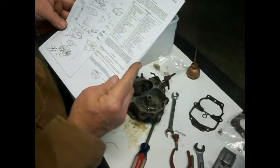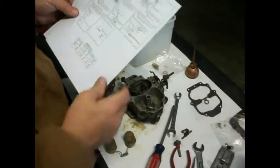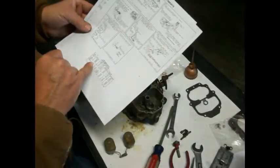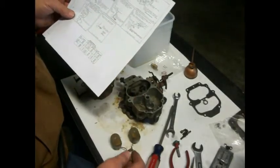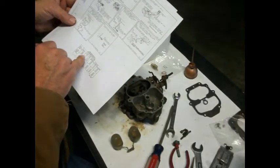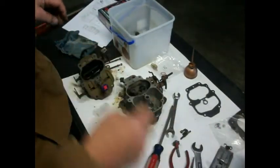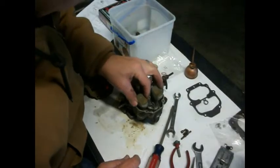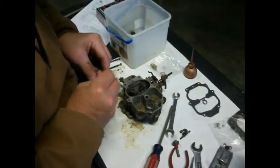Alright. Show you more. Okay, so what we got here is a failure to communicate with the auto parts world, but not really. They just don't have stuff back. So as far as the adjustments of these floats, it only goes back to 1981 for this. Apparently they use the same carburetor on several different things. So, but all of them adjust to 1/4 of an inch. So that's kind of what I was trying to figure out before we get too carried away here and put this thing back together. I didn't move these floats around any, and we didn't buy a new float and everything. So let's pop that down in there. And let's put our little retaining clip in there.